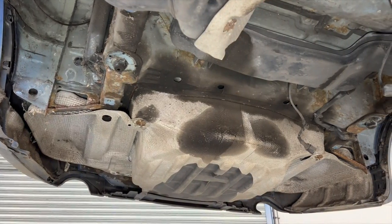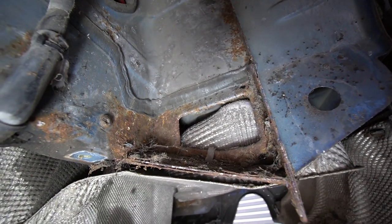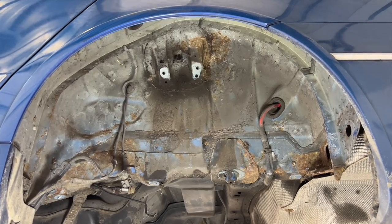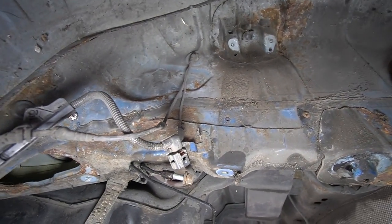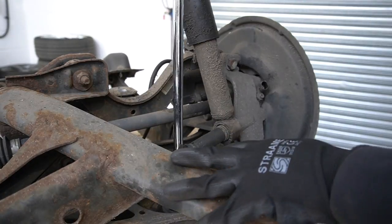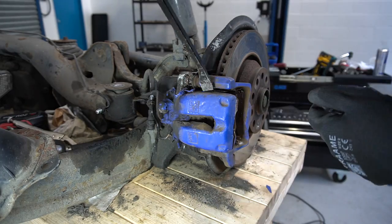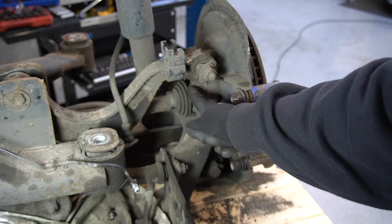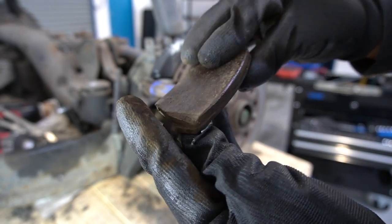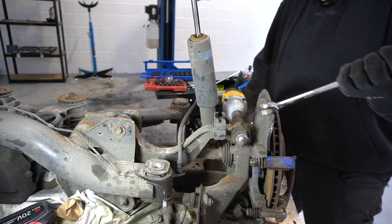It's in a lot better condition than the various Mk5s I've had, especially for a car that's done nearly 200,000 miles. The worst part is probably on the passenger side corner, and also where the suspension strut attaches — which reminds me of old Subarus that rusted the strut tower tops. The approach I took for disassembly was mostly random. I started with the suspension first as it looked easiest, but the lower damper bolt was completely seized into the bush so I left those attached. Next I moved on to the brakes — the calipers were pretty straightforward but access for the bigger M14 carrier bolts was limited, so I moved on to the upper camber arms instead. I can see a TRW logo on there so maybe they're genuine items — either way I've got brand new ones.